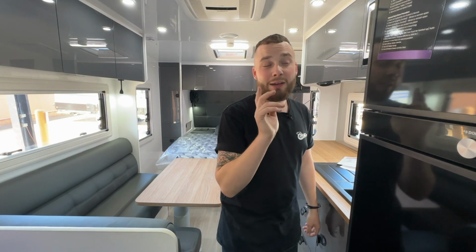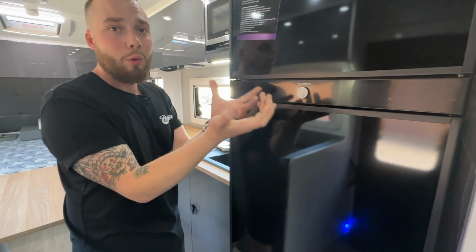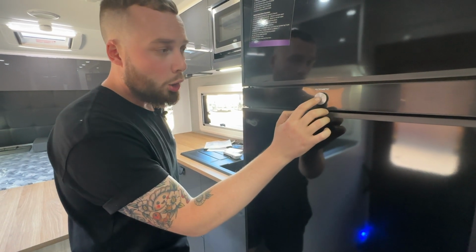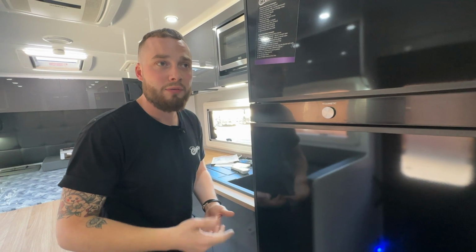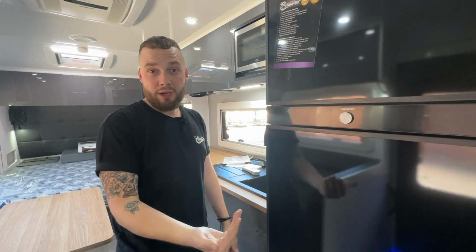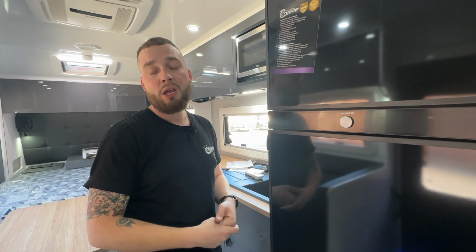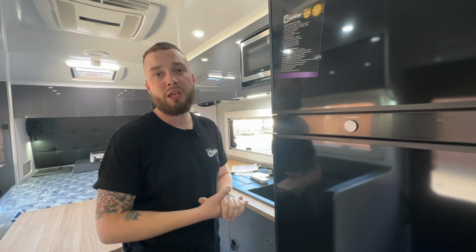That's it. To clear an error code, although very difficult to actually show you because it's so hard to make them error, you would hold this button down until it beeps. Once it beeps, you let it go, it will reset the error. If the error keeps appearing, look up the manual located in the description to find out what that error represents, and then contact your local dealer or local Dometic agent with your proof of purchase of the caravan whilst under its 3-year warranty period.